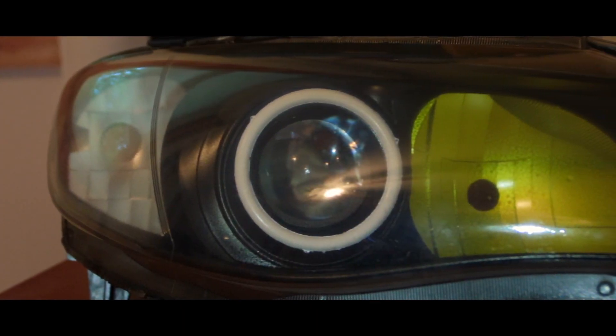The lights are done — everything is painted and ready to go. I'm going to heat up the oven again, put them back in. The halo is mounted to the housing and I really like it. Putting it back together is the same way you took it apart: heat the oven to 200 degrees, put the light in for 10 minutes, then put it together. I'm not going to wire the lighting today because I want to do it right — hidden and not a mess — and I need to be able to drive the car, so I just need the headlights to work.